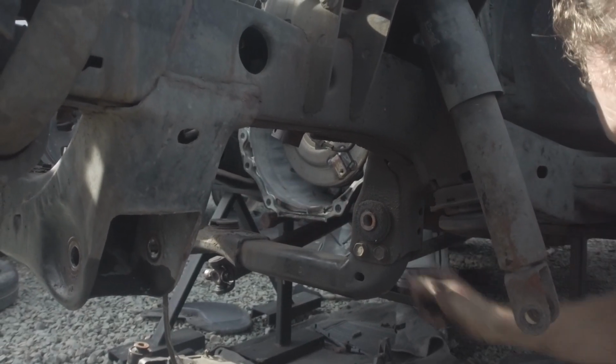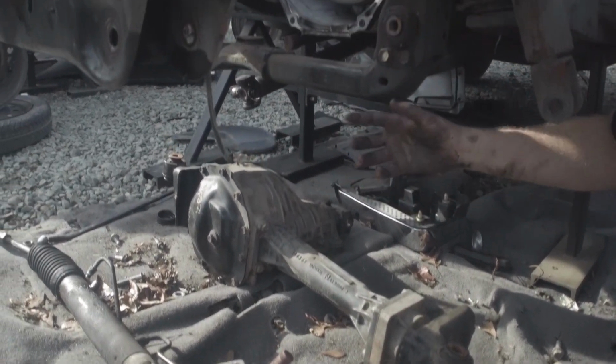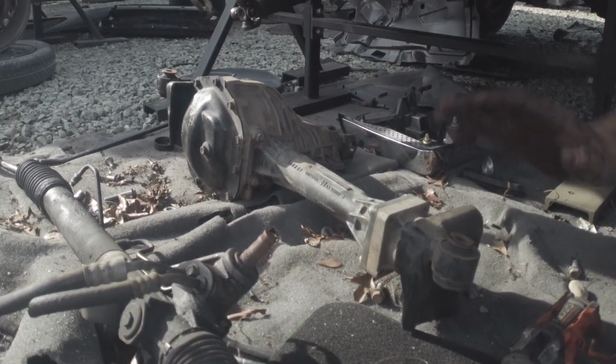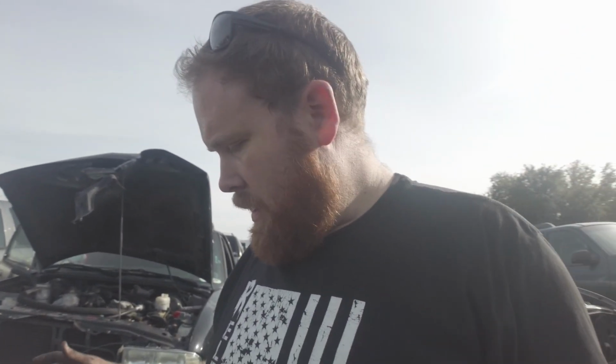If you've got an H3, the front diff hangers are only one bushing and one bushing up front with a third in the rear. I'm the only company in the world that's made a diff drop for this cradle, and that'll work with the H3 to get the CV axles right. So we're going to do that on Andrew's truck when we get this into his. I sent my wife off to get a cart, so we can move this back up to the front, but I'm going to take this front sway bar off real quick, and then I can move on to the back.